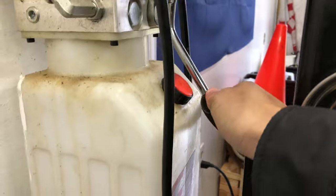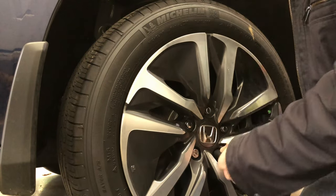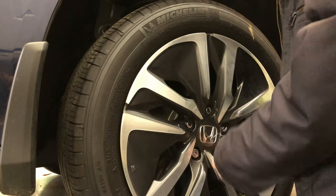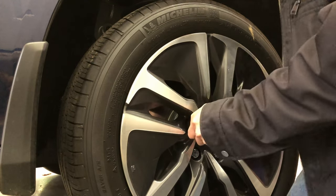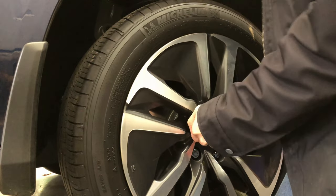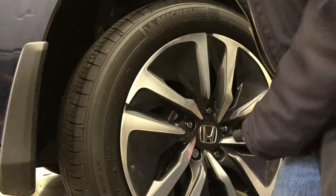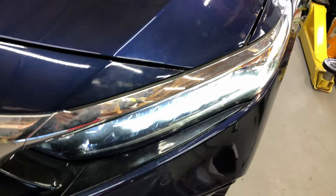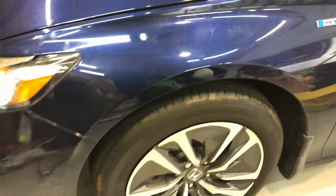I'm then going to slowly lower the car until the tires barely touch the ground, and then I'm going to tighten the wheels to spec. Here's the one time that I really used a torque wrench, because that's not something I can really gauge by feel. I do it this way because I don't want the suspension fully loaded. If you have an easier or better way, let me know down in the comments. I like to torque to 80 foot-pounds. And that should be it — I don't think it's too hard on this car. The hardest part is really getting it up in the air. If you found something useful in this video today, please like and subscribe, and I will see you next time.